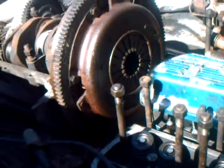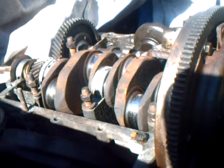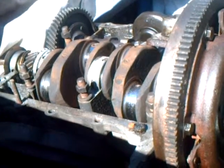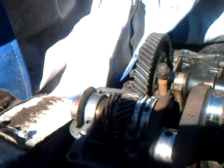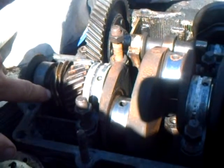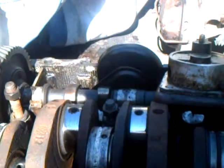I took this 1971 Super Beetle engine out of a totaled-out Super Beetle turned Baja Bug. It's got a bust case — it's a 211 case with 110 internal parts in there. It's got some pretty good damage; it took a hard hit and it's got a busted-off bronze gear that I've got to get replaced. Other than that, all the bearings are good. The crank's good, and it's got a 120 cam, which is still usable.